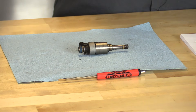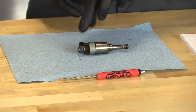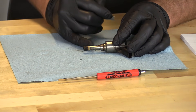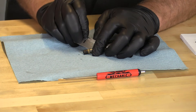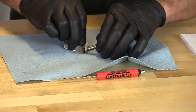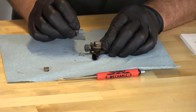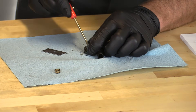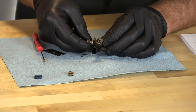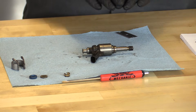The tools we're going to need are the injector kit, a fuel injector, and the seal kit which comes with five parts. I like to start by cutting off the old seals and I like to use a brand new sharp razor blade for that. You really want to be careful — you don't want to dig heavy into the metal. You just sort of want to lay the razor at an angle and cut away from you, just enough to cut the seal. You can also take a pick or a pocket screwdriver and just ease the seal off. There is also a plastic washer underneath that seal that has a split in it — you can just peel that right off and over the lip of the injector.